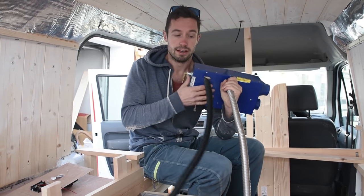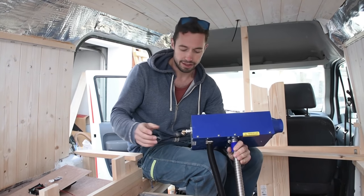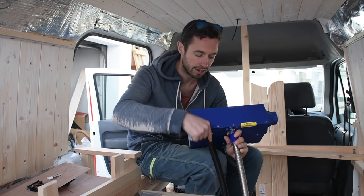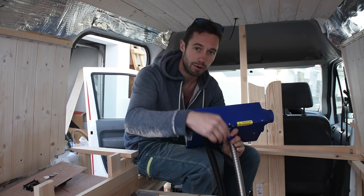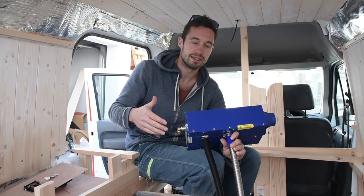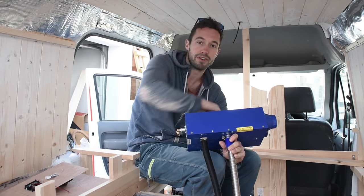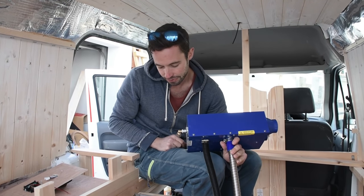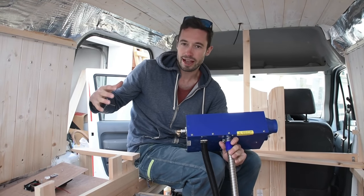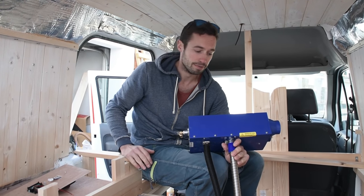These are the pipes. So the cool thing about this heater, and the reason I like these heaters, is that the inlet comes in, and this is the exhaust fumes out. So it burns it, throws the exhaust outside the van. So you haven't got any buildup of fumes inside, and it just makes it a lot safer. And all that comes in is cool air, and hot air pumps out the other end. So it's just to be safe, and not have a small gas heater where you fall asleep and it gasses you or something. I think it's much better.